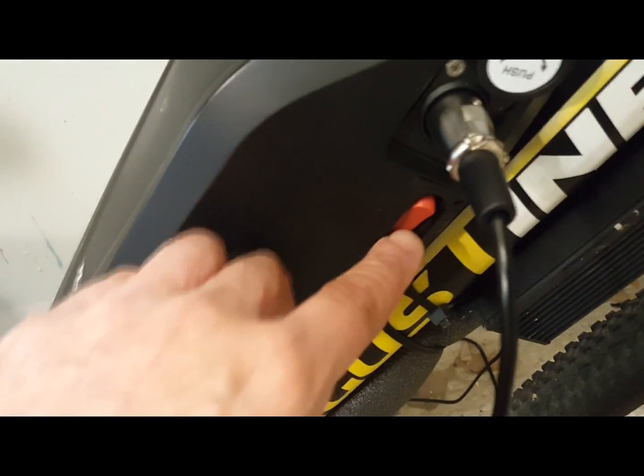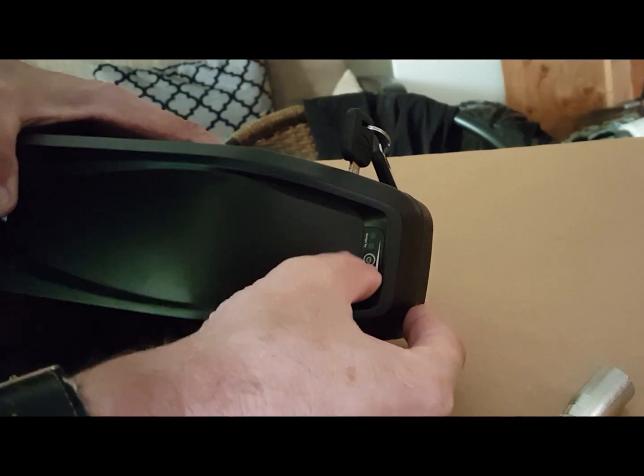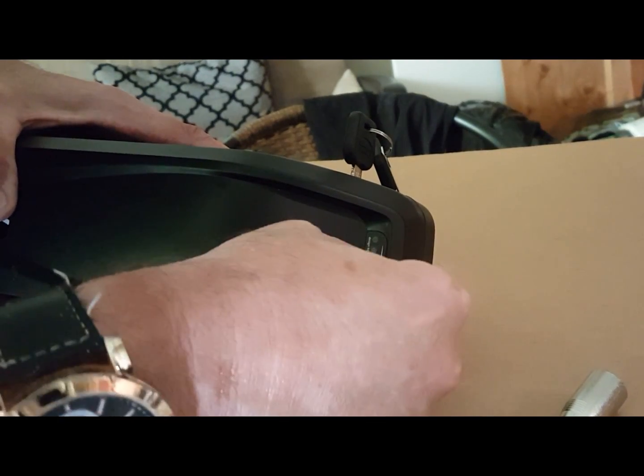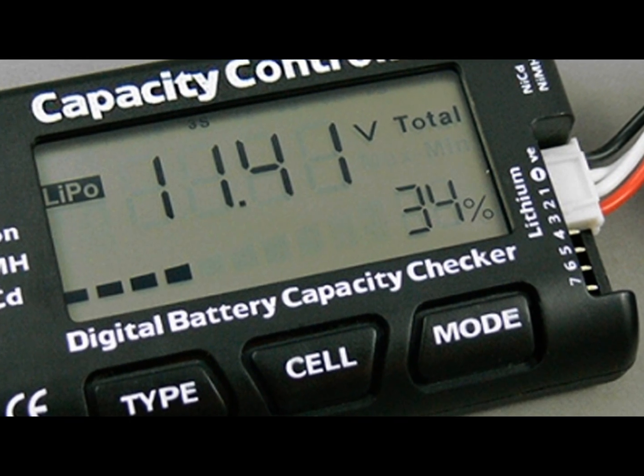So I asked him to connect the battery to the bike and then plug the charger into the battery, connecting it to his local house current. When he connected the bike, it worked — indicating that the problem was with the battery and not with the kit, and that basically the battery wasn't holding a charge. Since then he's gone off and gotten his battery fixed.